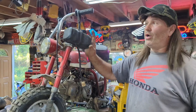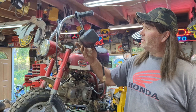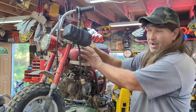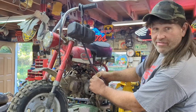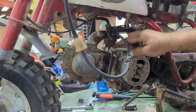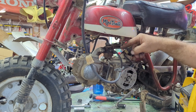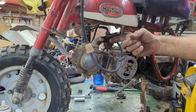All right, guys, so I put my little spare tank that I took off a roller tiller or something years ago. I don't know. But I put a little bungee cord on there. Thing works great for when you're doing jobs without one, if you don't want to put gas in the gas tank. I got a little filter on there, a little shutoff valve into the carburetor. We got the gas on right now. And I checked it already, opened this up, and a little bit of gas came out of here. So we know it's filling with gas. The float's working good because it ain't overflowing out of here. It's drier on the carburetor. I got the choke on.